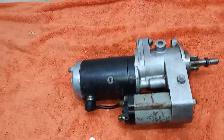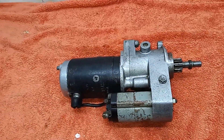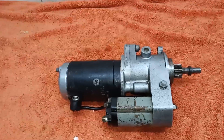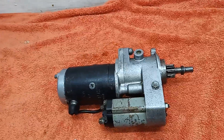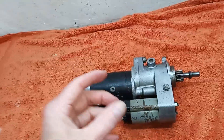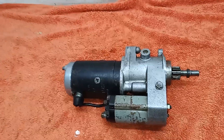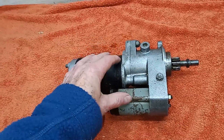Just a quick note on the starter generally: I find these starters work fine. Unlike the Norton Commando — the legendary 'starter assist' they called it, because the starters simply weren't man enough to turn the engine over — with these they generally work okay. The easiest upgrade is to simply improve the power cables going to the starter and to earth. They're very thin originally, so if you put in modern thicker high-current cables that will increase your power by at least 10, probably 20 percent.